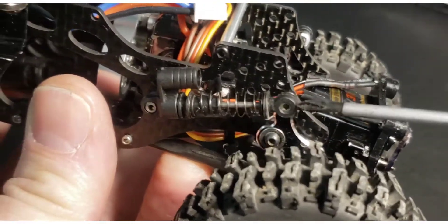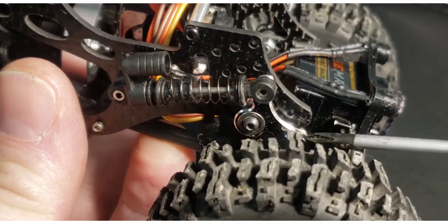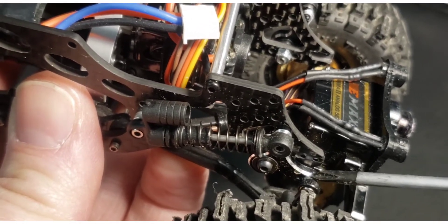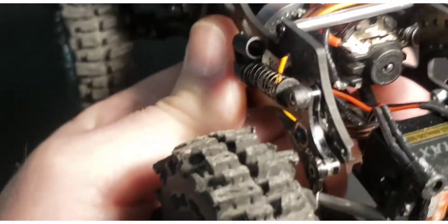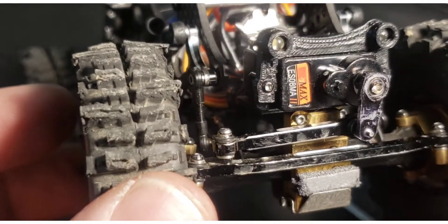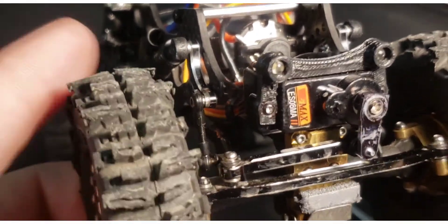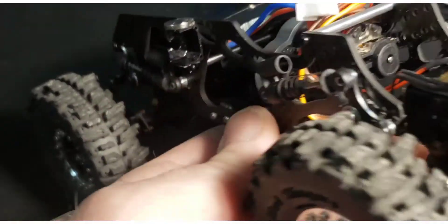With a small tire it doesn't matter what you do. On the front suspension I use both outer holes, especially with big tires. If I was running small tires I would still use the outer option. There are two holes on each end of the arm. Always use the outer arm when connecting the suspension to the link that goes to the anti-roll bar link.